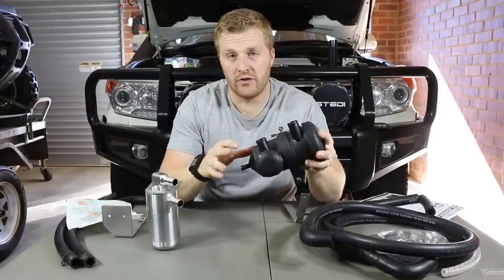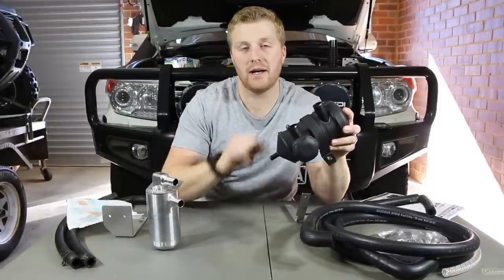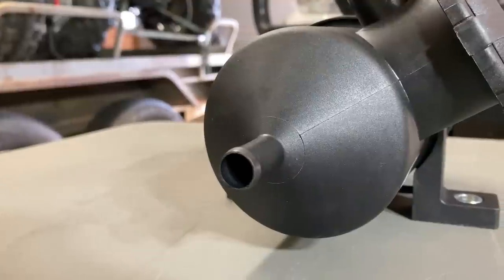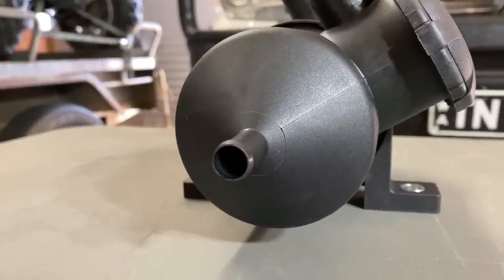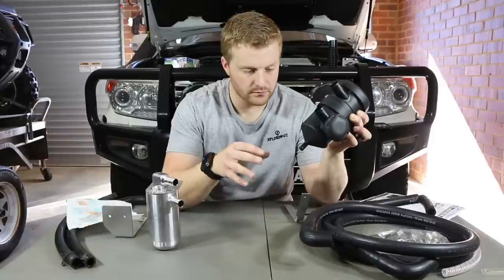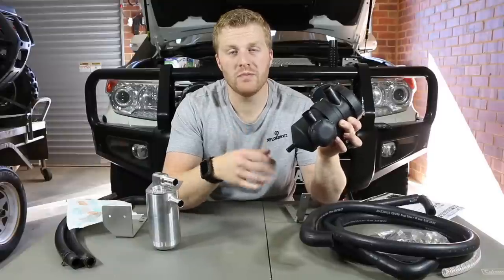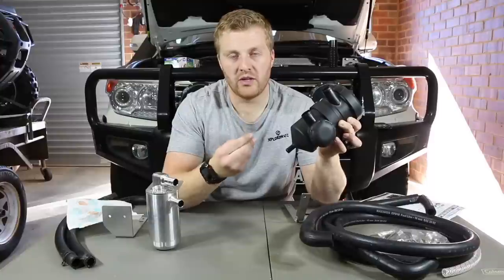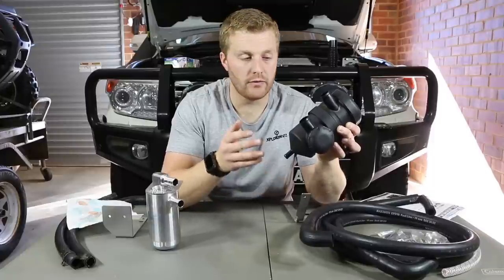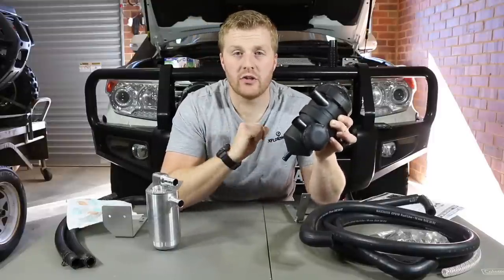There are a couple of other major differences. The first is the way it drains and is emptied. Rather than splitting in half and emptying a cup like the HPD, there's a port at the end where the oil builds up within the unit and comes out through a hose supplied in the Western Filters kit. You can have a little tap on the end and empty it from lower in the vehicle, like a wheel arch. You can also opt to bleed these hoses back into the engine sump, but that's not something I'm interested in — the oil is burnt, it doesn't have the same properties as clean engine oil, and I don't want to recirculate that through the vehicle.